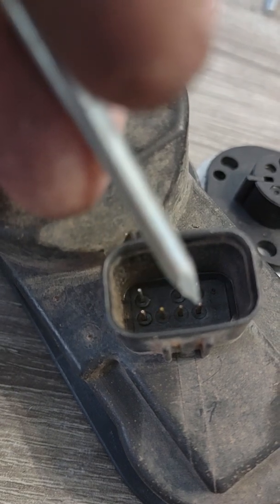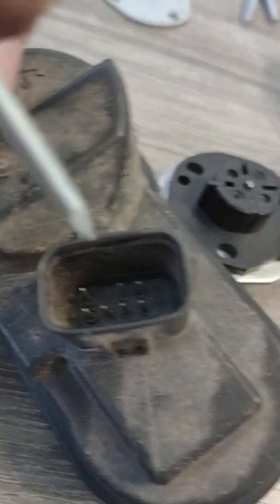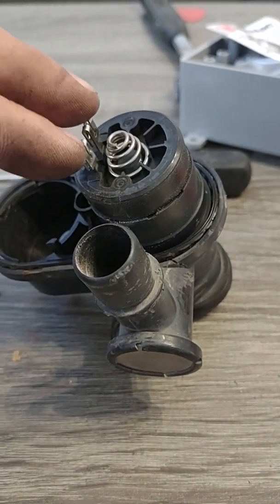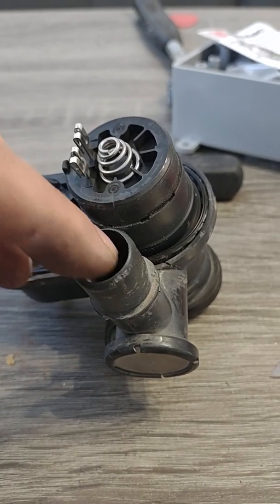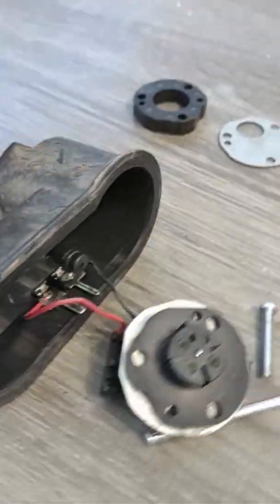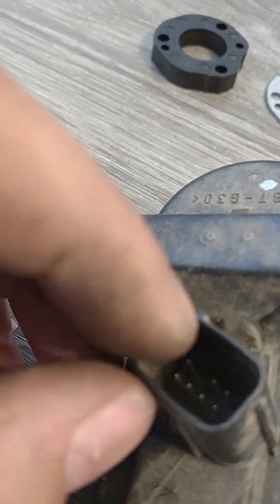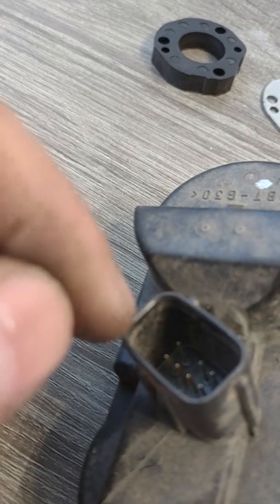If you think you're going to touch them, put something over them before you do the test. Outside the car you can test this — you'll hear a click click and you'll see on the back side there's a plunger in there and you'll see it move up and down. What that does is it closes off airflow. So when power is applied it goes down or up and then it closes off this flow. The failure point in this guy is this motor. The motor itself is fine — you can test that by those pins. Negative positive on the end here, those pins right there, and you'll hear it go.